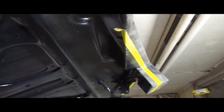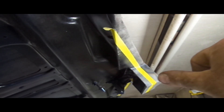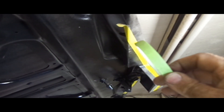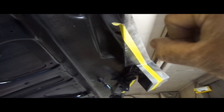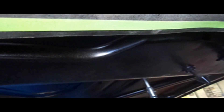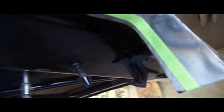So there's the cut line. I just closed the hood, took a piece of chalk, traced the line off the grill. That's three quarter inch masking tape, so that gives me a cut line. After it's cut, I'll take half inch tape and do the same thing. Then that little quarter inch strip that's sticking out — I'll fold it up, reinforce the edge. Done, nice and simple. So there's the half inch tape and that little piece gets folded around, which strengthens up the edge. It also hides the fact how crooked those cuts are.